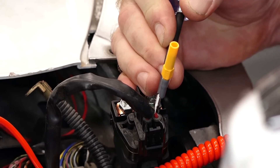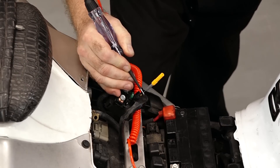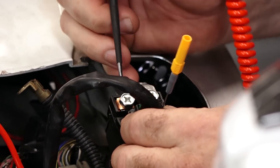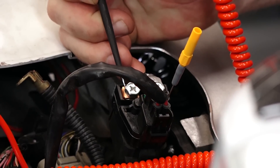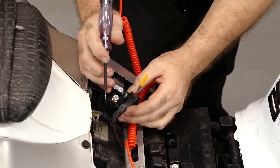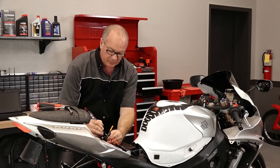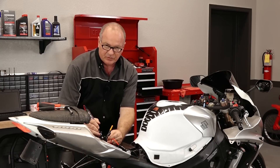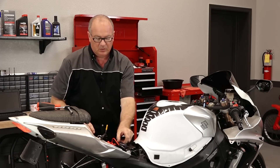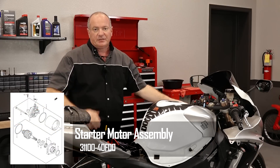Alright — hear that? And now you're seeing the light light up. Alright, one last test. To make sure the relay contactor is working properly, we should see power right there when we hit it. And that's indeed what's happening. So that tells me three things: that this switch is working correctly, that it's getting power to this location on the starter relay, and that the starter relay contactor is actually engaging and sending power down to the starter. Now if you've got all of that going on and it's still not turning over, chances are it's going to be your starter.